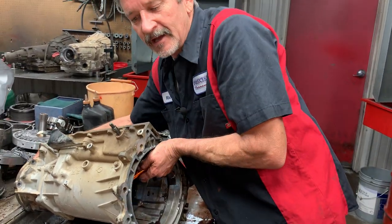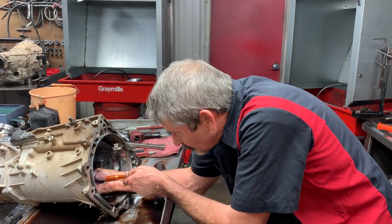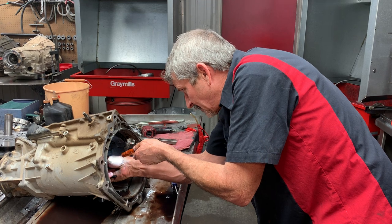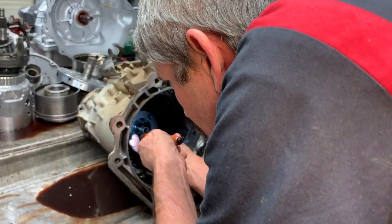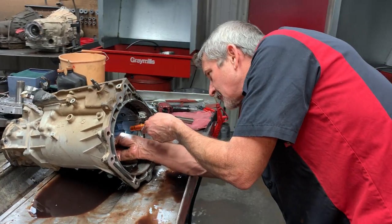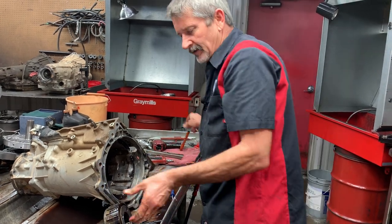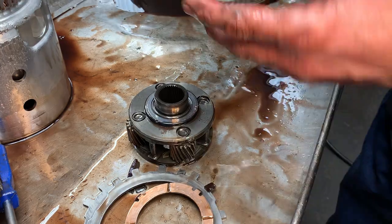We've only got so many hours to work today - and as you've seen on our last video, Trent's out there putting the rear end together and he's got that just about done. Mom is cracking the whip. We did get our big green pickup no-reverse done. That snap ring was worn - it's not my part. There it is - no biggie, the kit always comes with a new one anyway so you just throw that old one away. We do have our standard thrust washer support here which we'll go back with a roller-bearing style.